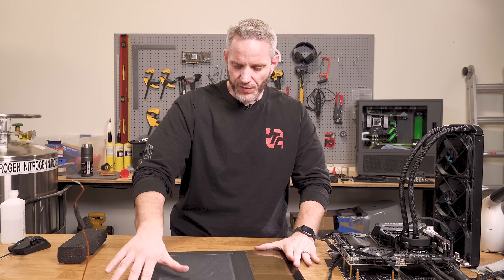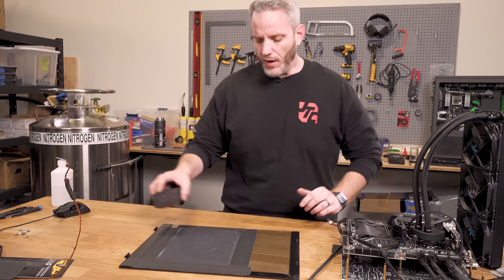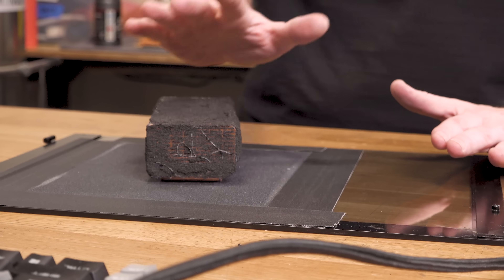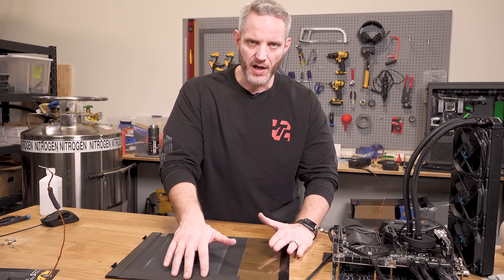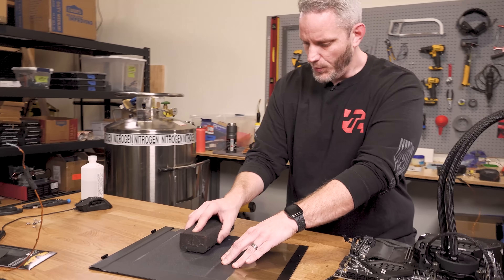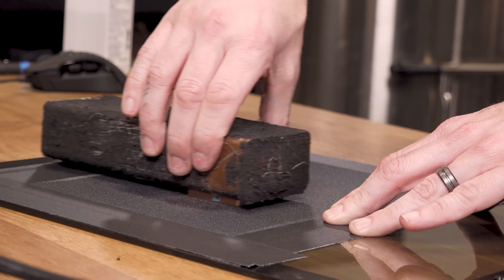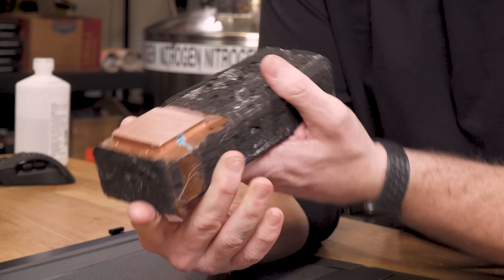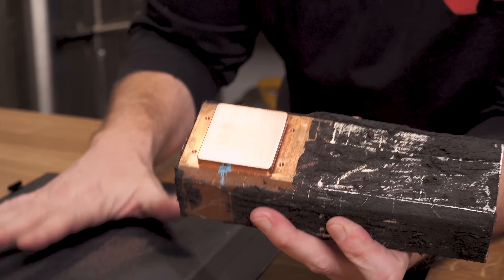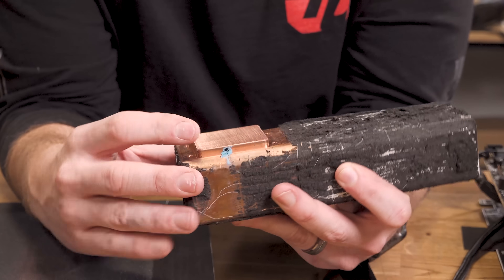We're also using a piece of tempered glass because glass is perfectly flat. I've just taken gaffer's tape — you can use duct tape or painter's tape — and taped down the sandpaper starting with my roughest grit. All I'll do is get as much pressure right in the center as I can. Not a lot; you don't want to push hard. The pot is really heavy, so its own weight is going to be fine. If you're using a water block or air cooler, just nice gentle pressure. I'll normally put water on here too. I'm looking for a pattern — the cross-hatching right now is really thick, and we'll be stepping to a higher grit so we don't end up making it too groovy.